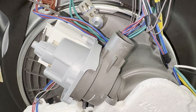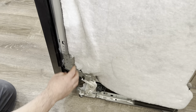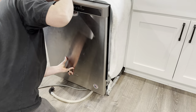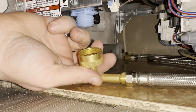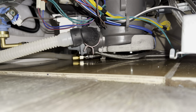With that piece of plastic fork out of there it should drain without any problems, so now I'm going to put it back together and run another wash cycle. As you put it back make sure this insulation is tucked in and covers the dishwasher as it helps it run more quietly. Also take a minute to clean the floor and space around the washer as it can get really dirty. The last two tips are to make sure the hoses aren't kinked or smashed and also make sure that the dishwasher is as level as possible. It's also critical that the drain hose is on securely, otherwise water will spill everywhere.